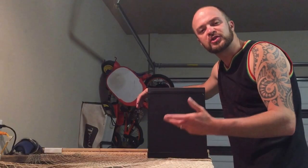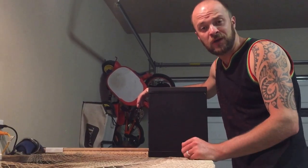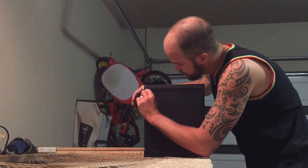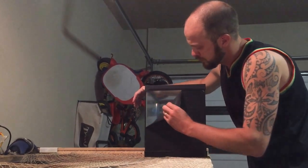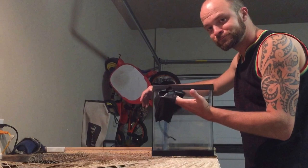Now that we're done applying it, we're going to let it dry. Give it a good two hours to cure. With Plasti Dip you can go up to it and lightly tap it in a corner — if it's still soft it won't be visible. I'm actually going to peel this tank to show you guys. I used a broken 10-gallon because I didn't want to peel a tank I'm actually using. Giving it about two to two and a half hours — now we're going to peel it off. All you've got to do is get it started with your thumbnail. Done.